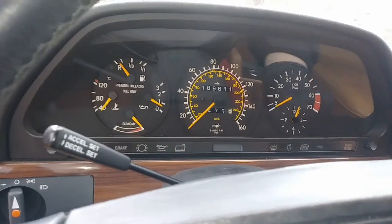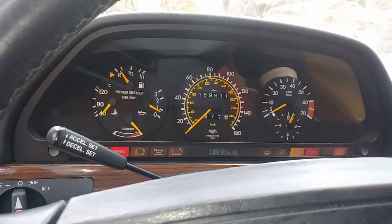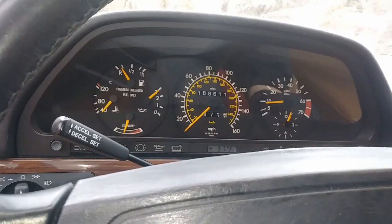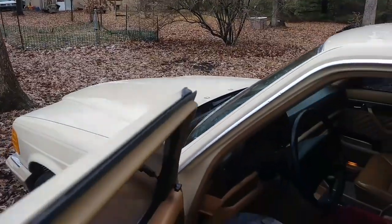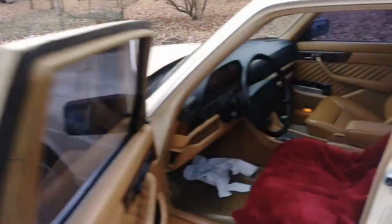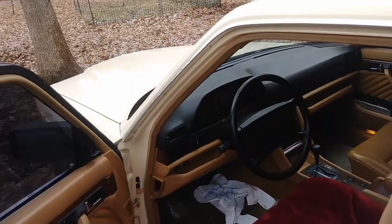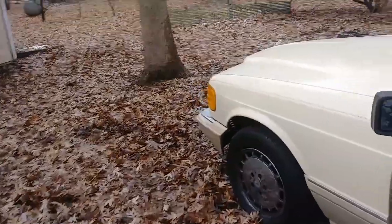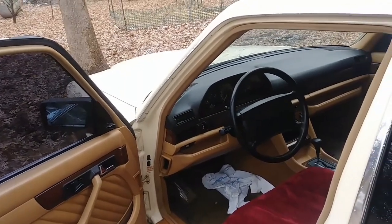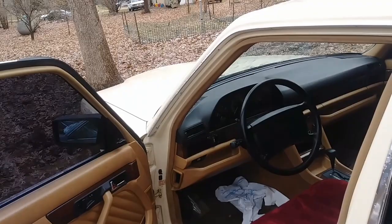I'm gonna prime the pump, see what it's gonna do. Oh yeah, it started right away. Okay. Alright. So actually, if you give it some couple of pumps, it's gonna be fine. So if you give it actually a couple of turns, then it kind of starts fine. So yeah, that's gonna be a fuel bleed down problem in the fuel pump area. Yeah, so I'm gonna let it warm up a little bit, and I'm gonna take it over there and we'll start working on this baby.